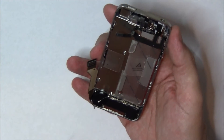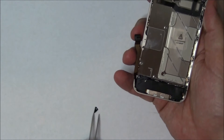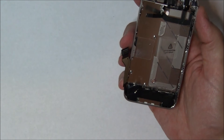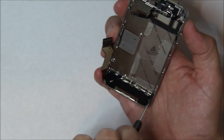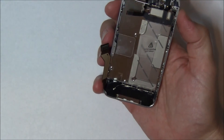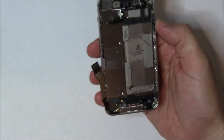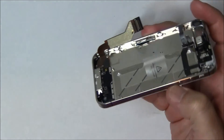If you're going to remove this, when you remove this left-hand screw, notice there's a little bitty plastic triangular piece that just fell out right there. That piece sits on top before the screw goes in — it's a spacer. Don't lose it; it only goes in one way. Then you undo the right-hand screw. Once you undo this, that bottom assembly just lifts right on out. Take your finger and lift up on it and there it goes. Now we've gotten everything out of the way. We're ready to undo the screws — there are 10 screws holding the screen onto the phone.